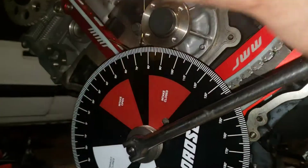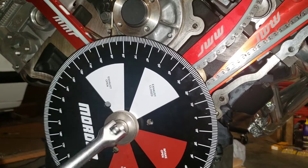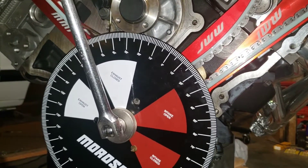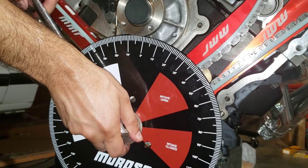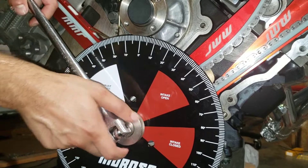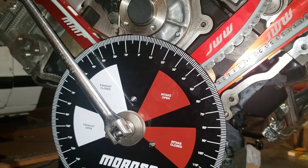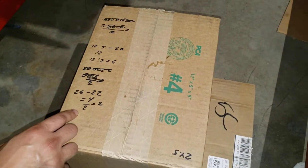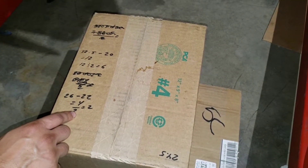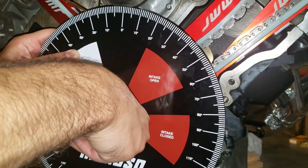Now we're going to go all the way around. Slow down until we're getting close to it. And it hit 22. So we're going to have to do the math again: we got 26 minus 22 which equals 4, divided by 2. So we've got to add 2 on the smaller side — this side is 22, so we're going to move it over 2 to make it 24.